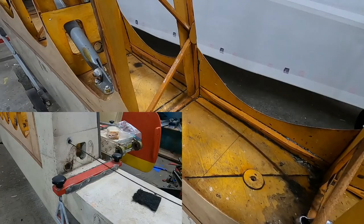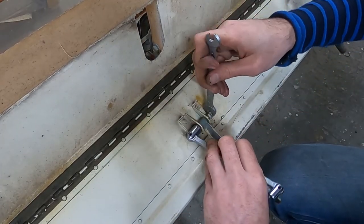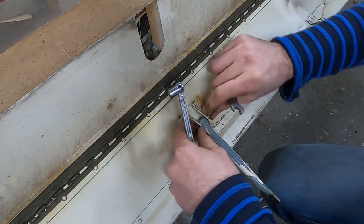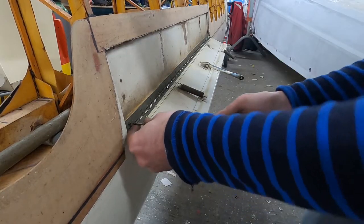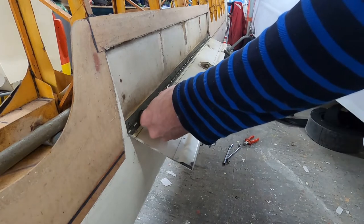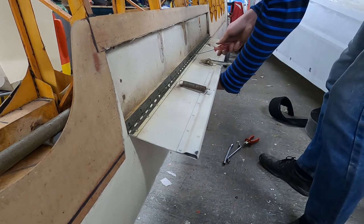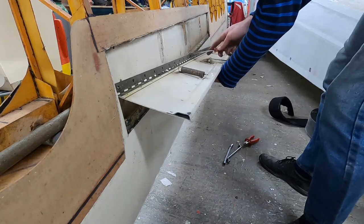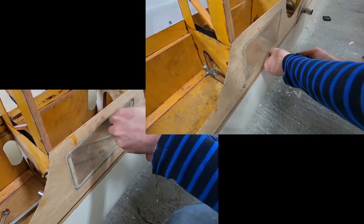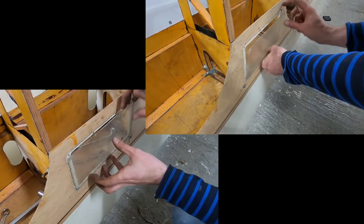After that, the cable can just be pulled out of the wing. The only thing left on the wing now are the actual airbrakes. We undid the nuts for the small control rods, but couldn't get the bolt out yet. Therefore we decided to just unmount the entire airbrake from the wing first and remove the control rod later. It turned out that some careful taps with a small hammer were sufficient. The airbrakes themselves are mounted with a lot of small self-tapping screws directly screwed into the wing structure. Although most were easy to remove, some were bent and will eventually be replaced with new ones. On the bottom of the wing there are two inspection windows which we removed — we might even polish them later or make new ones.